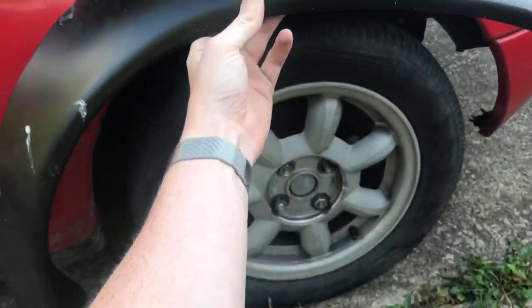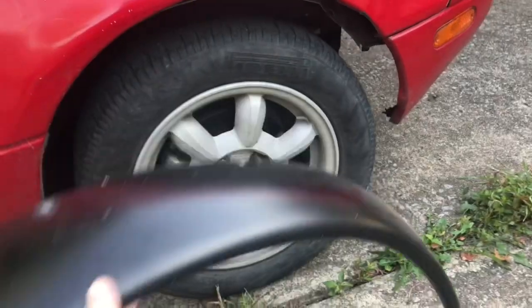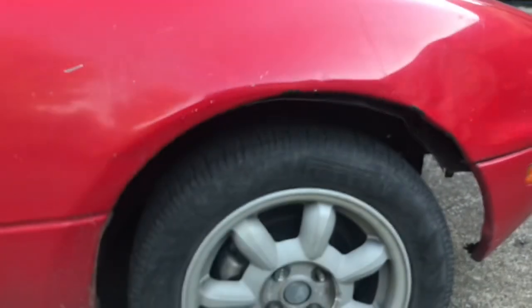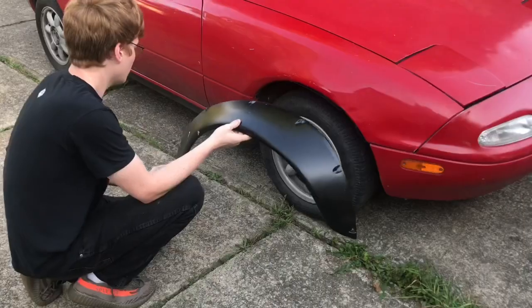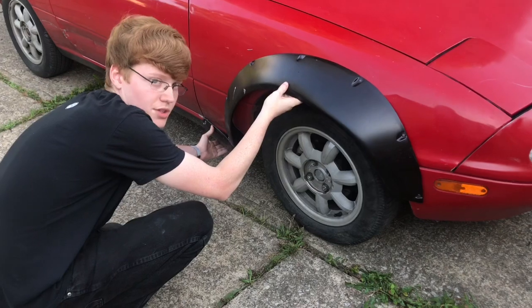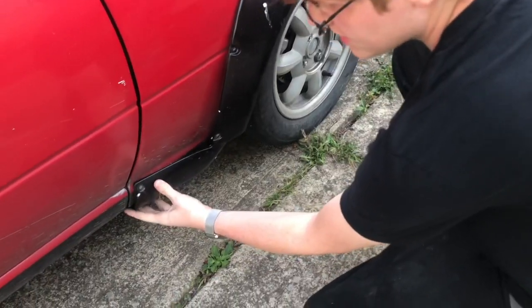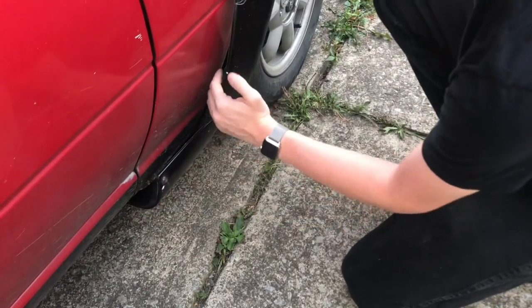The way that these work is you literally just bolt them here, kind of. There's some more prep involved. You cut away the inside of the fender and make it so that you can run thicker tires, because this lip is no longer there to chew into your tires. Currently, if you try to offer it up to the car, it doesn't quite work. This makes contact here — this needs to go all the way to the edge of the fender to the door, and you can see that just isn't working.